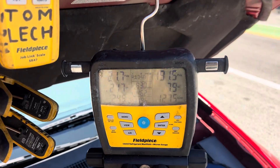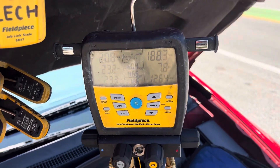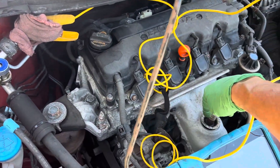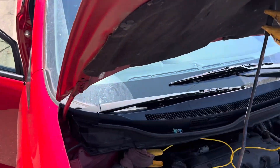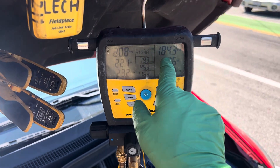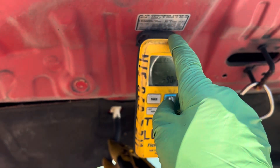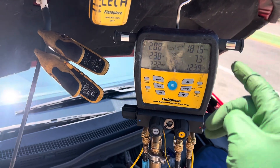Look at the high side — we're no longer at 209 psi, we're going down. We're in fresh air mode with all that hot air off the exhaust manifold and radiator being sucked right in, windows open, full maximum load. But look at our high side pressure: 184 psi. We added 100 grams to bring it up to 425 grams, and our high side pressure went from 209 down.